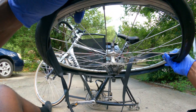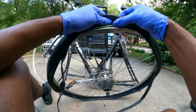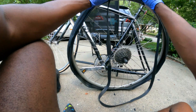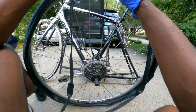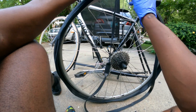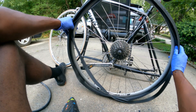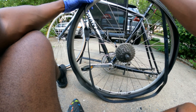What I'm trying to do is get the valve through that hole. Now that's lined up, I'm just going to push it through — this is one of the most important parts to get seated correctly, because if you don't, your tube could get a pinch flat almost immediately. So now what I'm doing is just tucking the tube in to the tire. I'm going to work in the lip of the tire and the tube at the same time, starting here and slowly working my way around.